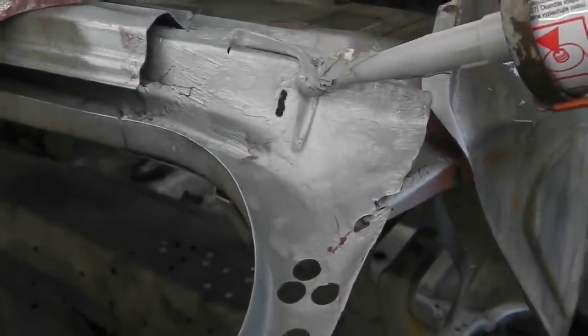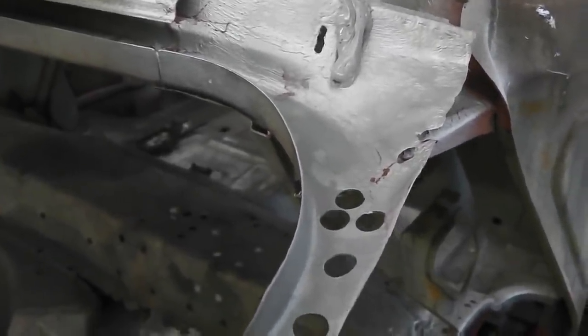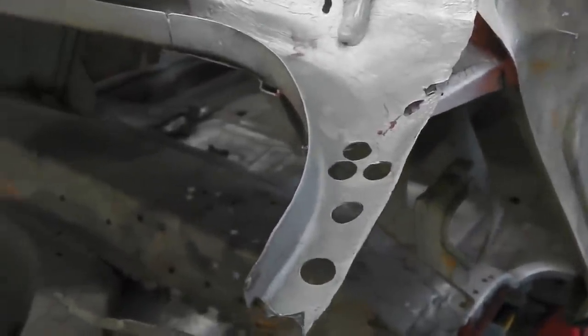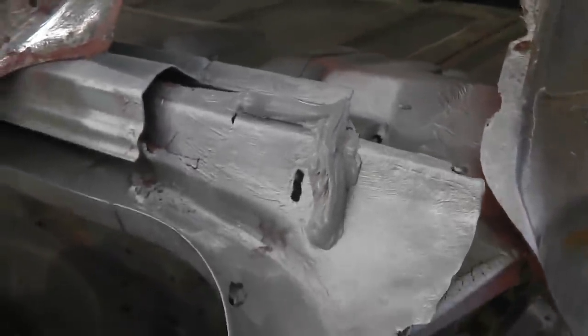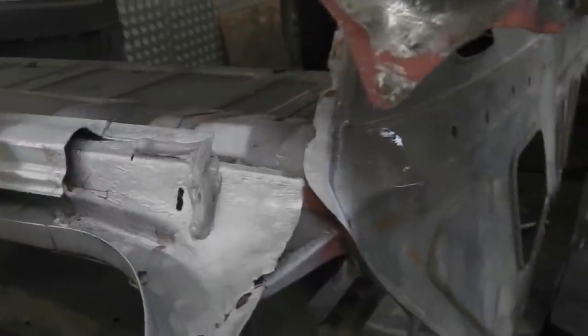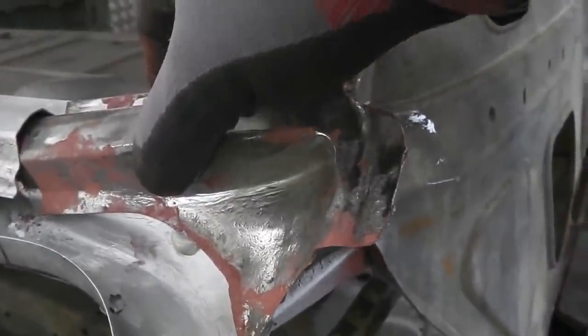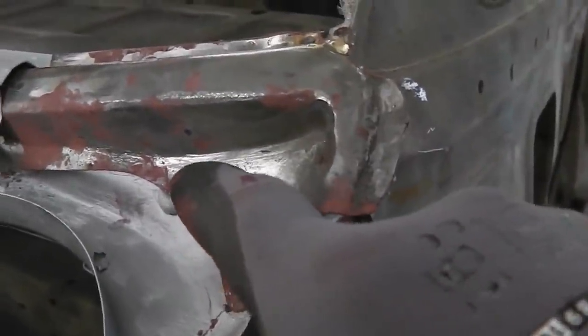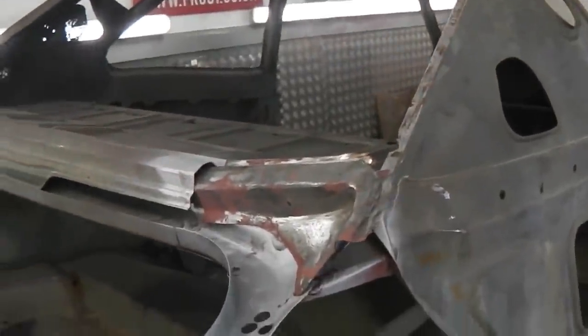The downside, of course, of a shell dip, even with the pros, even with all the big boys who do it, is that, sorry, that's in, is that seam seal on there. Of course, when you get your car dipped, various different dipping companies, but I think they all get rid of the seam sealers. I don't know if there's a process which you can dip and it doesn't burn off the paint, because that's the only problem. You lose little seam seal things like this. Whether you'll be able to get to it, I don't know. You could with your quarter off get in to this end, I suppose. So you have to make a list if you dip your shell of what parts you'll lose in terms of that sealant.